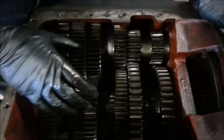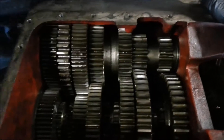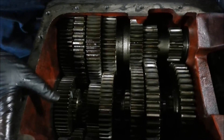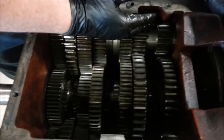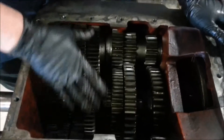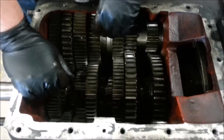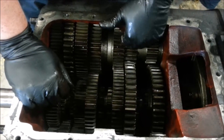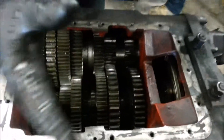When you look at all these gears, on each side you have what are called counter shafts. What this does is — if your engine is putting out, say, 1,400 pounds of torque — the counter shafts distribute the foot-pounds so you only get 700 on one side and 700 on the other, for a total of 1,400 pounds. The reason you do that is because if you tried to put all 1,400 pounds on one side you'd break the counter shaft, so they split it up to even out and differentiate the load.